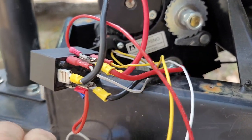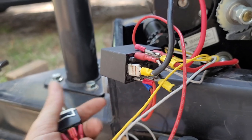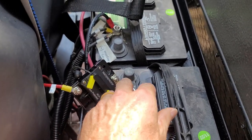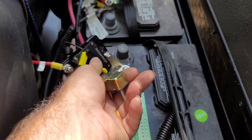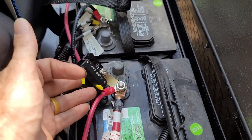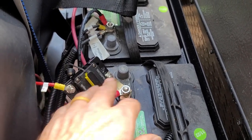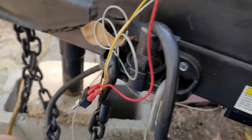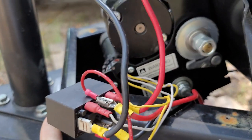I am down all the way now. Which way is up, which way is down — it's hard to do this with one hand. I forgot to tell y'all: I'm going to move this too because my battery box lid won't fit on it. But instead of blowing that little eight-dollar breaker all the time, I went ahead and got one of these resettable switches — that way if something happens it's going to flip, and if you want to reset it you just push that down and you're ready to go again. So I'm going to rewire this and put it somewhere, probably down in here, so I can get the lid on.